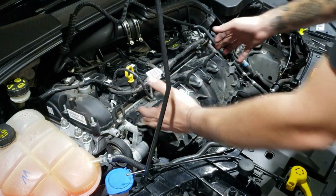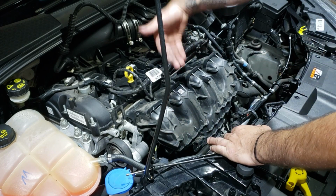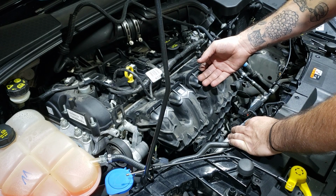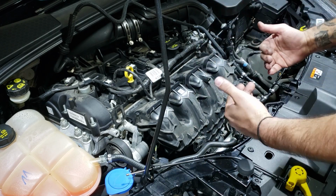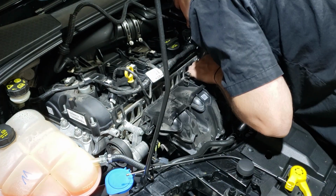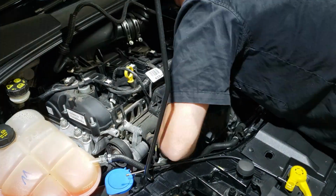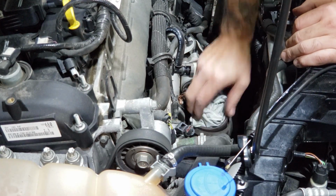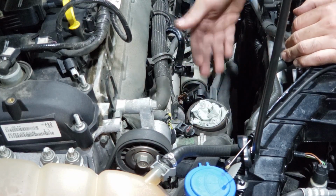Pull the inlet manifold back slightly and it will give you access to get your arm down there to unplug the throttle body and to unplug the PCV connection. I'll show you the PCV connection off engine. As soon as you've got the manifold off, take a clean rag and put it in the boost pipe, so if anything drops in there, it won't fall down in.